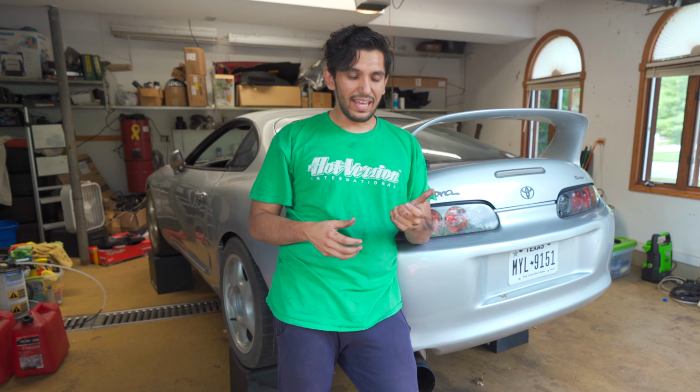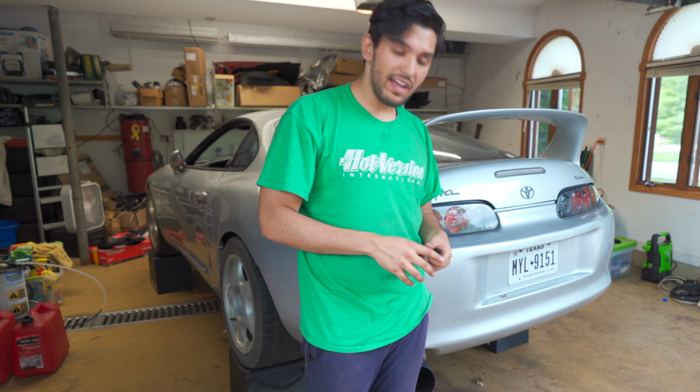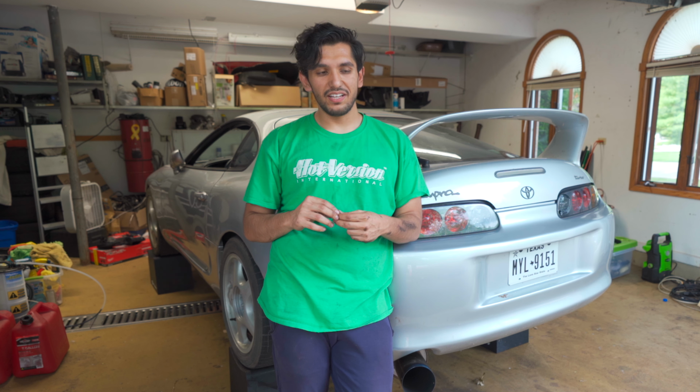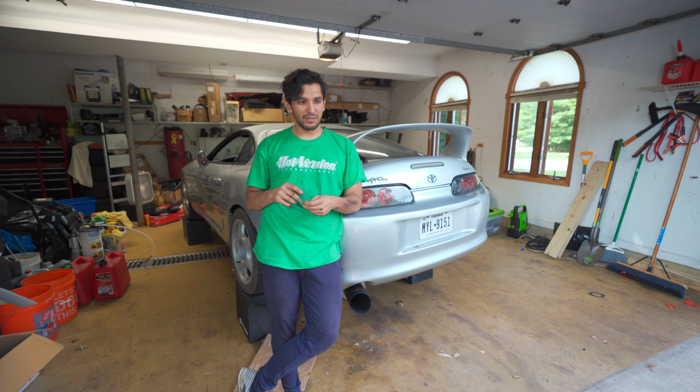I was like, man, why is it so loud and why does it smell so bad? And this explains why we weren't making any boost, because the wastegate's just dumping everything out. Hey, the car sounds half decent. If the wastegate's closed, then we'd get a better sound clip, but we'll see. Maybe we can fix the wastegate today, but if not, then that was our triumphant success.